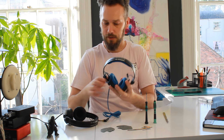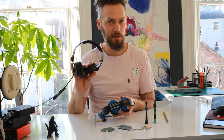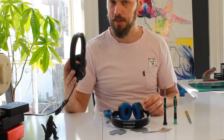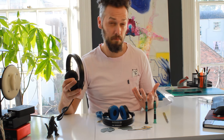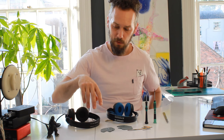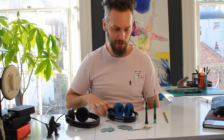With the HD25 more than any other headphone I've tested, they really need a burn-in — the diaphragm needs to loosen up before they sound their best. What often happens is someone has an old pair of HD25s used for years, they love the sound, they put on the new ones and they sound totally different because they haven't burnt in yet. Also, the pads over time flatten down, which affects the sound. Old pads sound different from new pads, and as the pads break down the sound will change. I've given these a bit of a burn-in, let them run for a day or so.